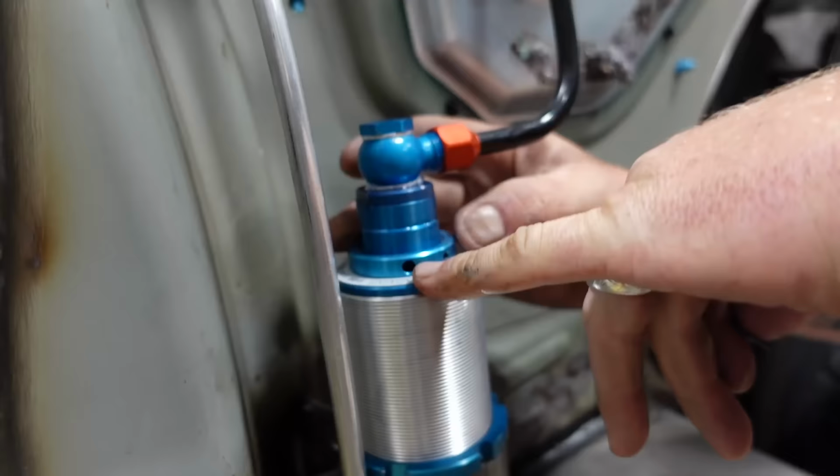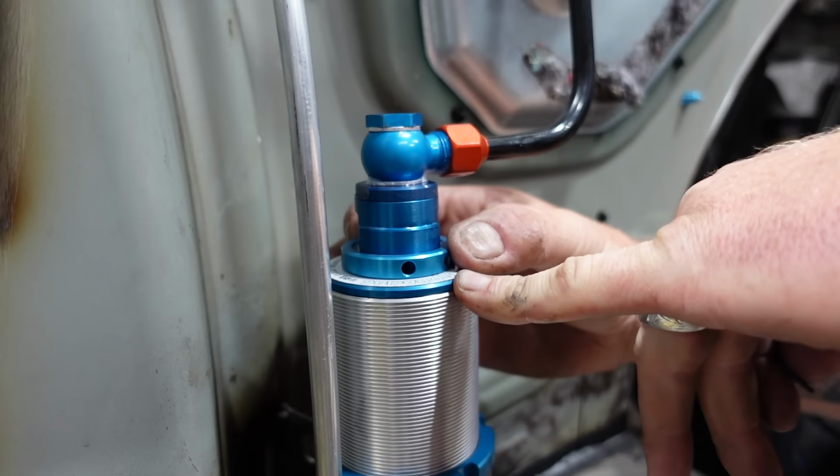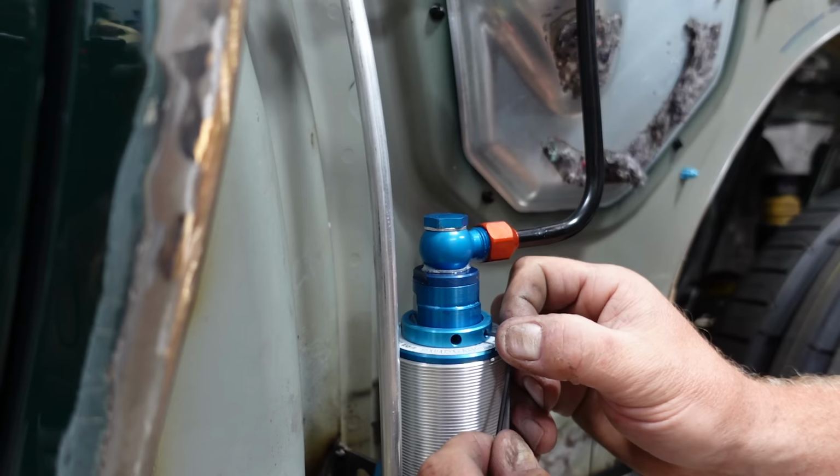To adjust the exhaust flow, there's a port. There's probably four or five of them. You see how the hole's open? And I can just close it whatever amount I want. So honestly, we could probably close them, have all of the excess go out the back. But I'm just going to go full open rear and then half in the front, since that's what we're really worried about. So this way the back will drop first, the front will go slow.